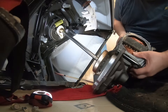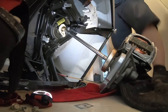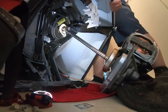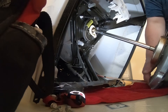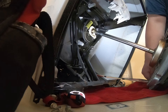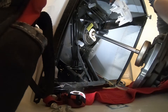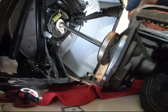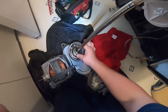I just realized I need to lean the washer a little bit more. It's best to lean the washer all the way to the floor — you should disconnect the water hoses from the wall and lean the washer back. That way you work more freely. I was trying to do this repair quickly because the homeowner needed to go, so I left the water hoses connected, but my suggestion would be to disconnect them. Here's the wire in the clamp — just move the wire out of the way, then remove the transmission with the whole motor on it.